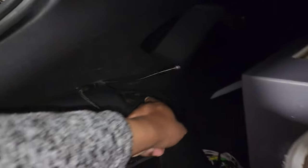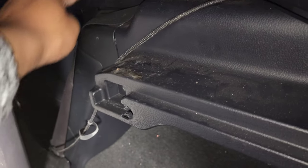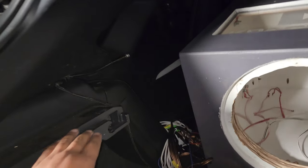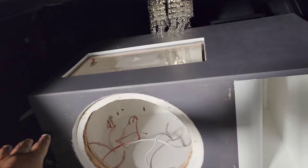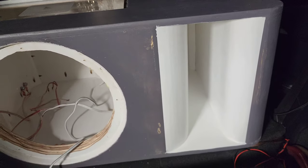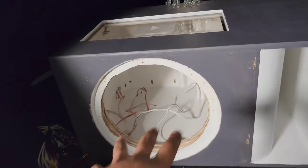Here's how the amp rack sits. There are little cutouts — divots where the seat belts come out — and I've utilized those to lay the plywood over the box so the amps rest above it. My new box is taller, so I may have to put the rack in the window cutouts to keep it high enough above the box. I've already measured it out — I just need to test fit and cut some wood to keep them where I need them.